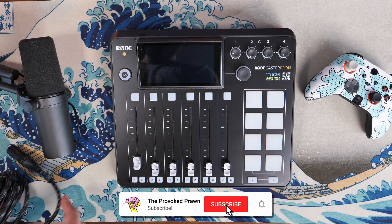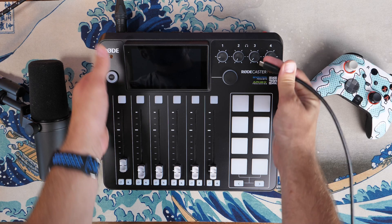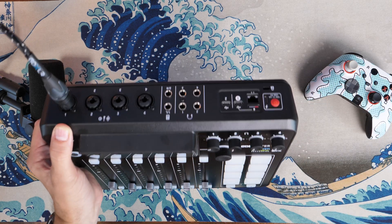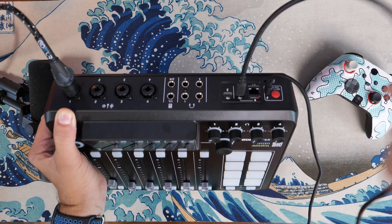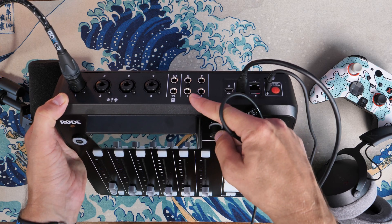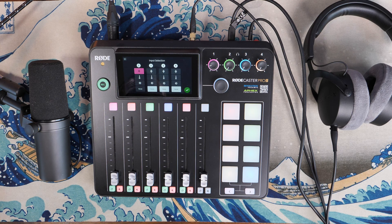In this video I'm going to be using the Shure SM7B as my only microphone. This is also for a single PC setup, but I'll show you how to use both USB ports later on and the reasons why you might want to do that. So obviously plug your microphone in, plug the power in as well. Then plug in the other connections including USB 1, which will be the main one, and then plug in your headset or headphones so you can monitor your microphone and hear all the audio. The initial setup is actually fairly straightforward.